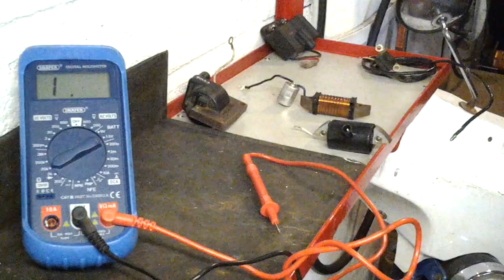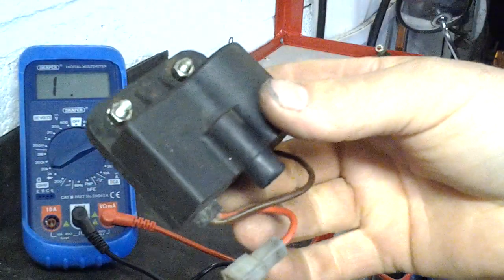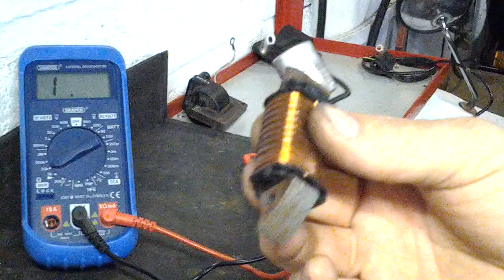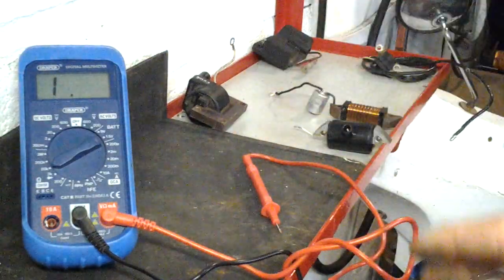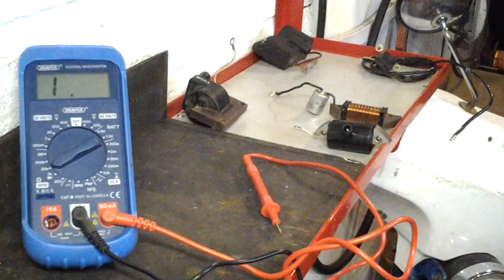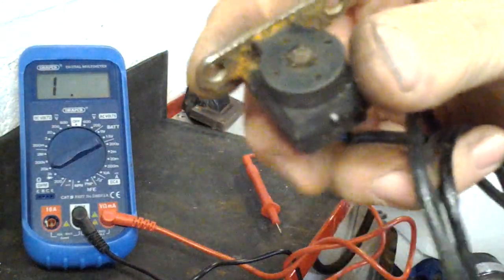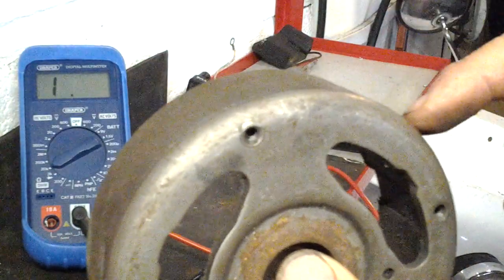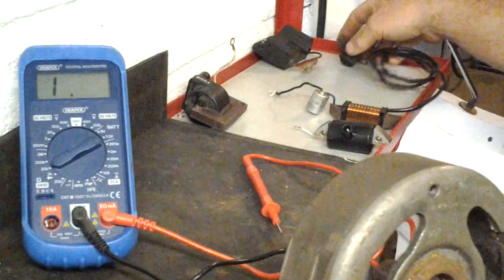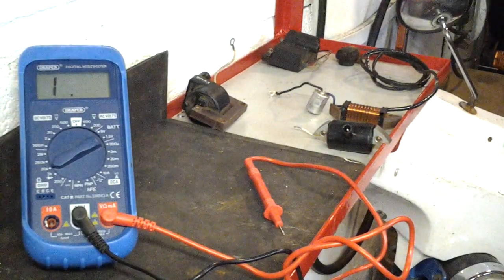The later A35s and A55s had an electronic ignition system with no points or condenser. The external coil for those looks completely different. They didn't use an internal magnetó coil for ignition power — instead they had stator windings just for producing general electrical power. The actual trigger pulse for the external coil came from a pulser coil fitted to the outside of the magneto. A small magnet on the flywheel passes the pulser coil without touching it, and at that point the pulse tells the ignition coil to send the spark to the spark plug. No moving parts apart from the spinning magneto — so less prone to failure, but they can fail.